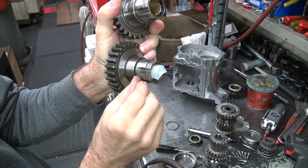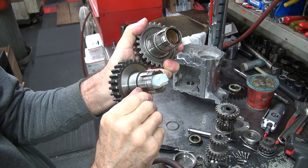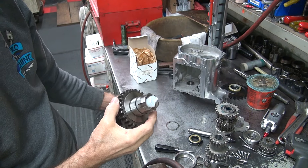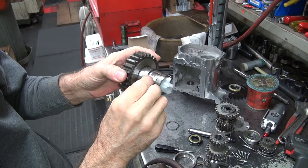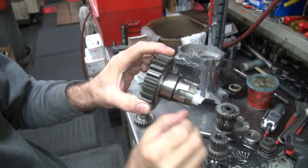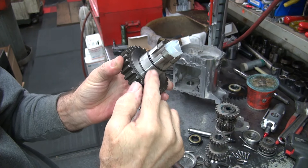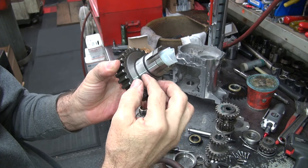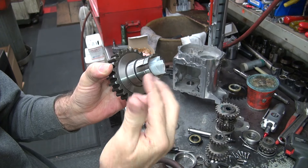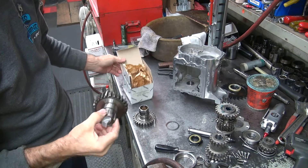They are different sizes, so you don't interchange them. If you notice, there's an O-ring right here, and that's what seals your sleeve when you put it on there, so it's cut deep for that to go in. This one has a groove here, but this is an undercut — it's not an O-ring groove. When you put your seal spacer down on top of that, that's what seals it. The groove is on the gear, so you're not cutting the sleeve down for the O-ring — you're cutting the gear down for it. The sleeve slips right over at full strength and doesn't collapse when you tighten your nut down. If you cut the O-ring groove into the spacer, it will collapse when you torque on it and it gets loose.